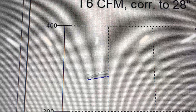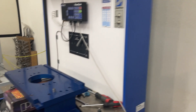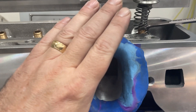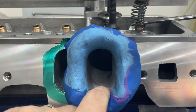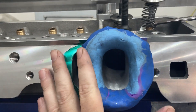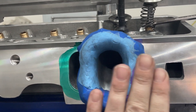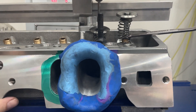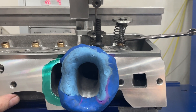That one actually was a little worse. I'm not saying it because of flow — it could be just because of the clay, because this is tough. I really should have just done a machine entry. I did this test, but we'll try one more time at 60 and see if this bench does it. What'll happen is this side will start sucking in, like closing off its entry. I know clay, but usually it works. At 28 inches it doesn't really have a problem, but with these higher depressions — and when it's warmer the clay is more elastic so it tries to suck in — but anyway let's try 55 inches... and then 60, and then I'm probably going to call it.